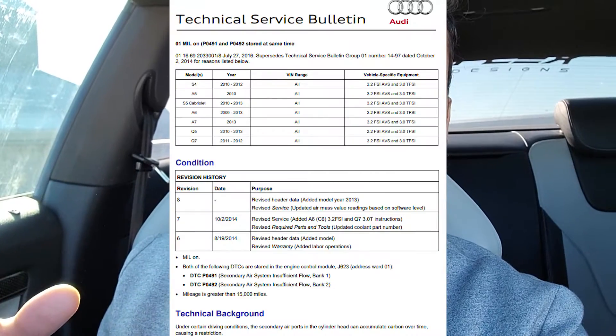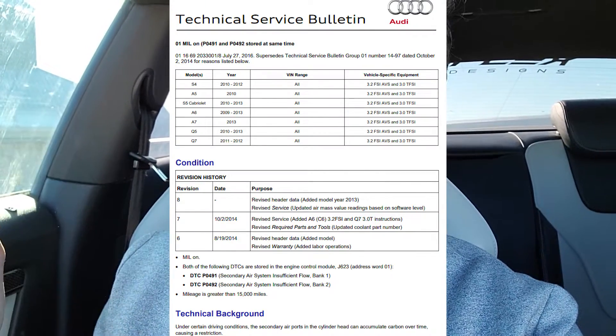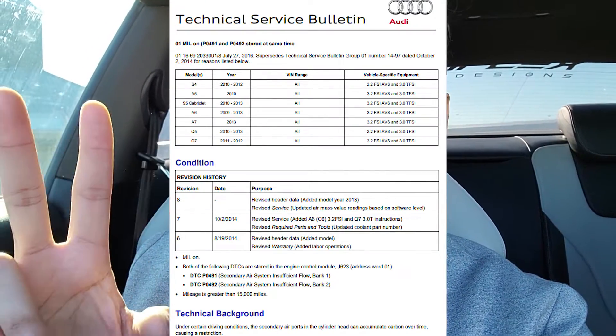Just worry about the secondary air pump — it's not a major issue, but to clean it is a lot of work. I think 2013 and earlier you might be able to get it on later models too, but with the B8.5s there's an actual TSB — a service bulletin warranty — that would get it cleaned. If you get both banks for the secondary air pump check engine light before, I think, 120,000 kilometers, check with your dealer or check with Audi using your VIN. If you can get it done for free, it's a big headache off your plate.